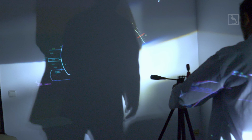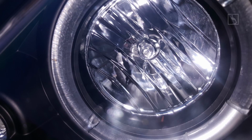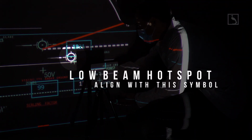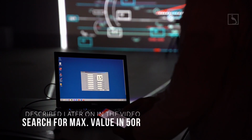Step 9. Connect your headlight to a 12-volt power supply and power up both the low beam halogen and high beam LED. Step 10. Check the radial position of your LED. The LED needs to be sitting in the focal lens point. Slowly rotate left and right until one of the two may happen: 1. The highest light intensity, or 2. The socket wall is touched. Your purpose is to reach scenario 1.